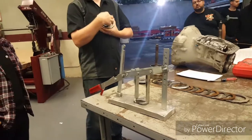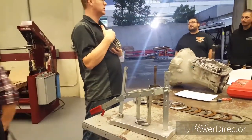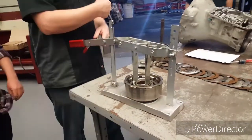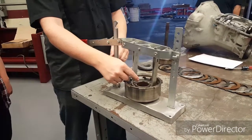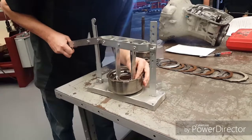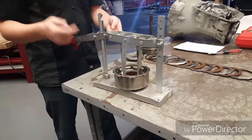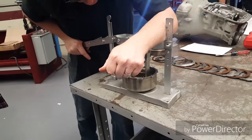If you've got one of those, they come apart much smoother and more carefully — they don't get any of that weird twisting and turning. However, if you do have one of these springs, just come up real careful with it. Just like before, we're going to do exactly the same thing: get your set in there and make sure that the snap ring is facing outward so you can get to it. A couple of weeks ago I had groups where they had turned the little teeth inward — it makes it really hard to open it up. So start developing that habit of getting your snap ring out where you can get to it.